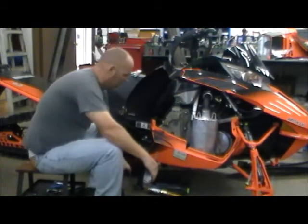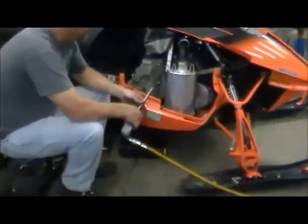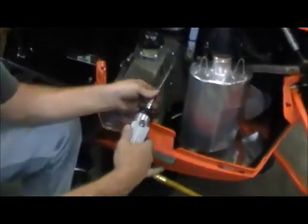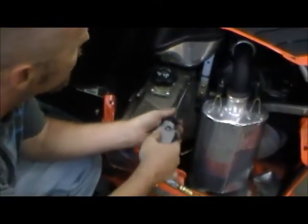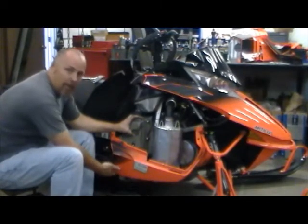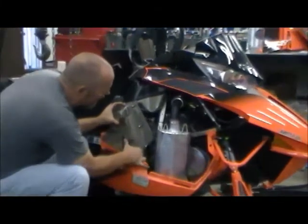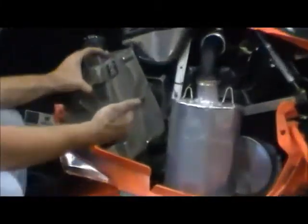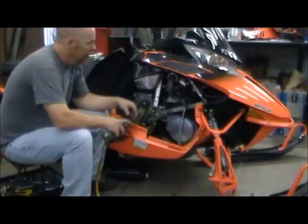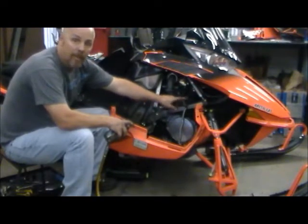Now that we've removed this screw and the stirrup, we'll go ahead and remove these inner screws that undo the chain case cover itself. You don't need to undo the oil tank, just the chain case cover. Remember, as you remove that cover, there will be oil that comes out — there are holes in the bottom. We have a drain pan under here. As you pull this out, try to keep your oil line up high. If you get an air bubble in there, you're going to have to go through Arctic Cat's bleed procedure. Now we've pulled the oil line off the bottom of the tank and tied it up here to keep from getting an air bubble in the line.